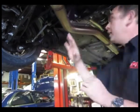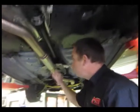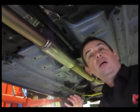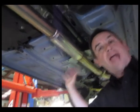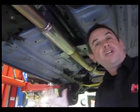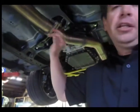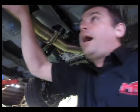Right, so if you've got a modified car, or particularly this particular model with the lowered springs that we've fitted to it, you want to get the camber right to get the maximum life out of your tyres, but also the maximum grip when you're pushing the car hard either on the road or the track. And you can see here we've changed the rear exhaust system with an MRT 3-inch sports exhaust centre muffler, because remember on the Forester with the increased cabin size, you do have an increased risk of booming or drone at freeway speeds.